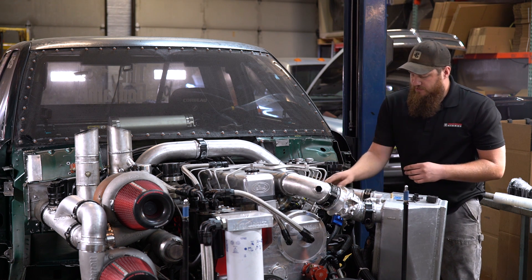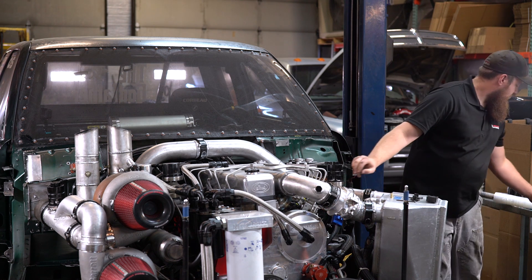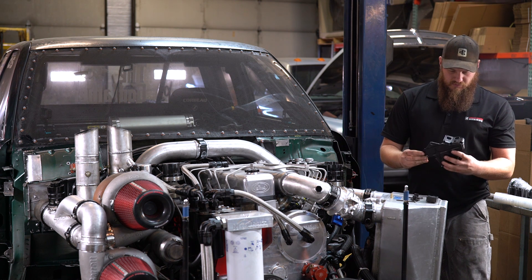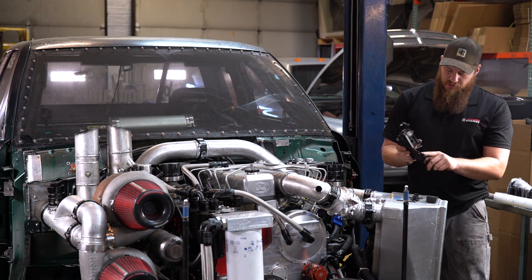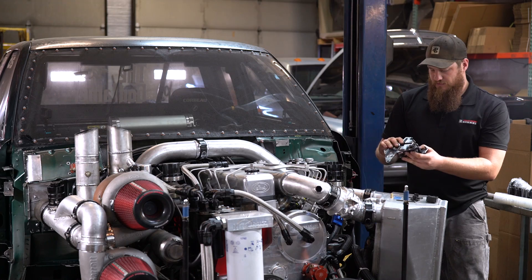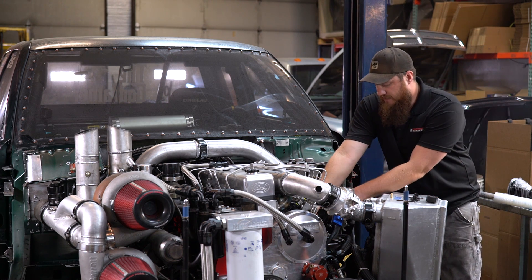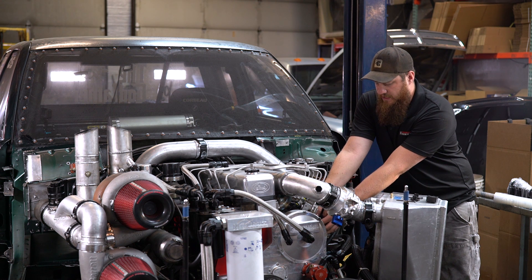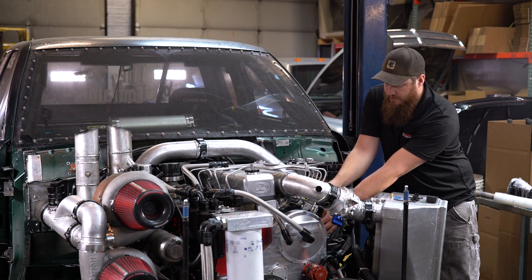This bracket is located differently on this pump because it's got different tapped holes in it. You'll need to — there are two or three bolts that attach this bracket to your injection pump. We'll take this clip off — I can get this one with my fingers, but you might need to stick a screwdriver underneath it to get it up and off. We'll set the clip there.